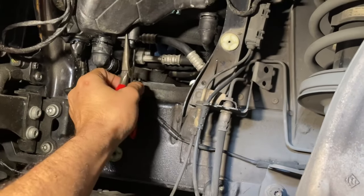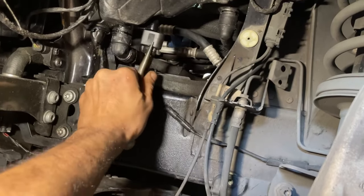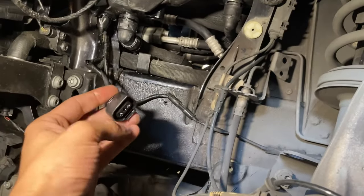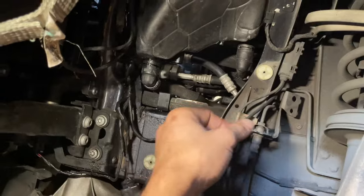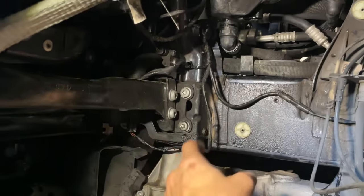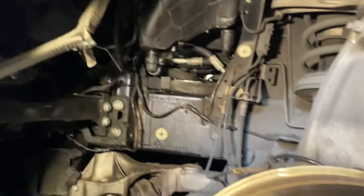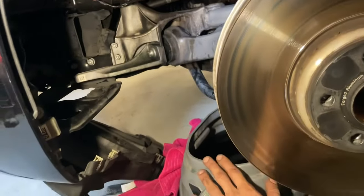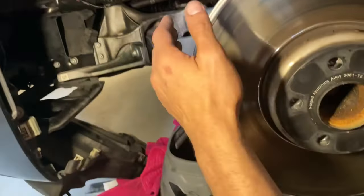Squeeze that clip — my god, look, it flooded the sensor! Man, that thing was cooked. Put this to the side, make sure you lean it over this brace bar so when we flush this out it doesn't get all wet. The next thing you want to do is get a bucket — something you can drain the little bit of coolant that's left in the big tank. Make sure you get a few rags to put around in case you miss.